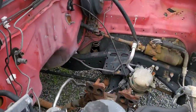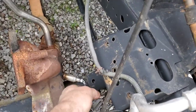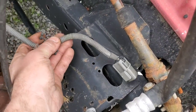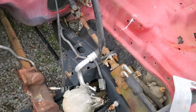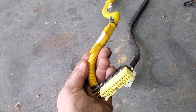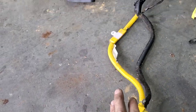I've pulled out all the wiring from under the hood, so everything just got relabeled. The rear O2 sensor I'm not going to use — everything is going to be highly modified, and I'm also removing emissions. Anything with a yellow harness or yellow plug will be your airbag, and that is not going back in either.